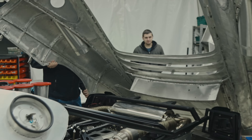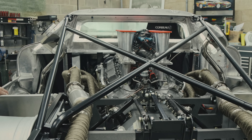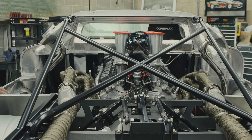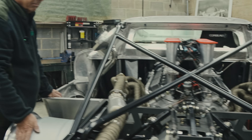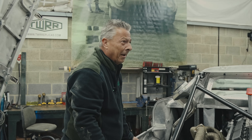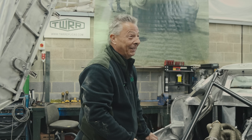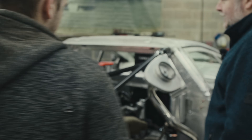We've got to put two batteries in because you can have some rather large fans sat on the front of your radiator. The ones on the 13 draw 73 amps on startup - there's two of them. That's fine when they're running, it's just when they first kick on.